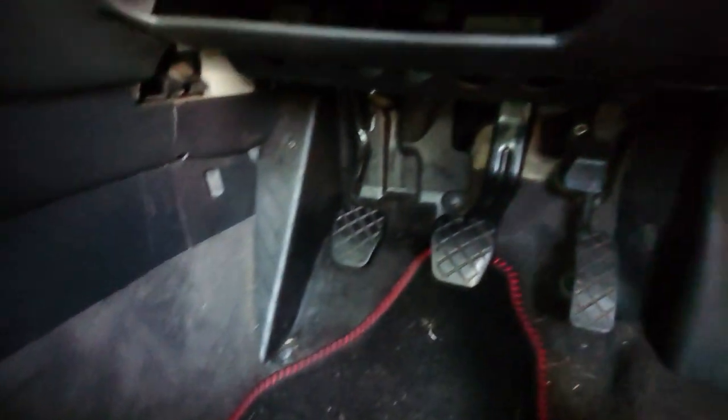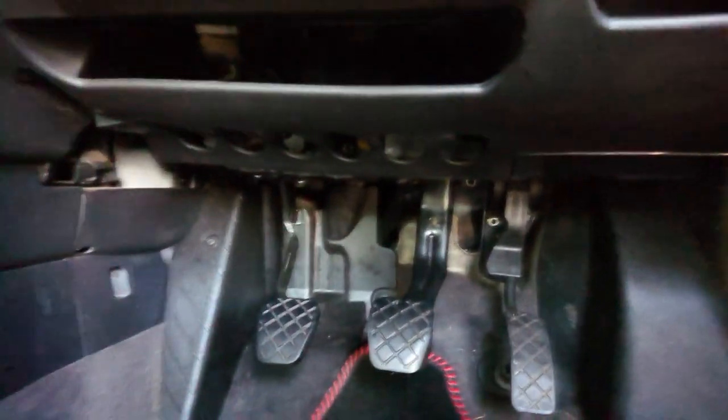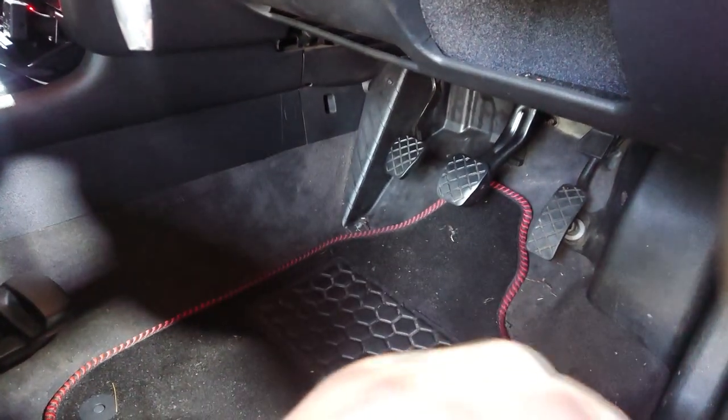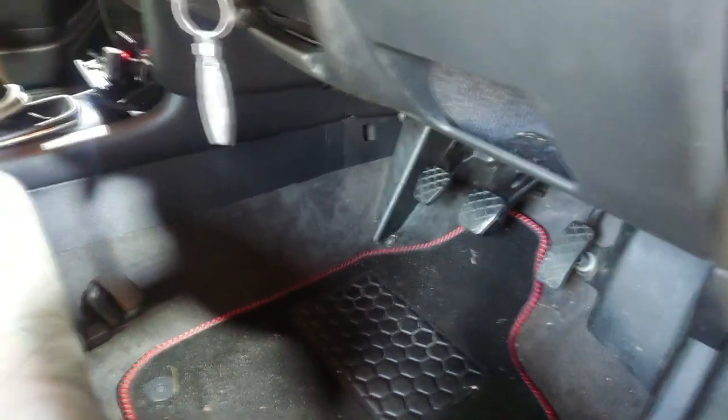We'll just get this new one in the car. As you can see, you pull it in like this and make sure everything's clicked in, then start pumping. With this new one everything should be good. The master cylinder is in on the clutch side. We bled it with a bleed nipple — as you can see we've got it all back in operation. You do the pump technique: press down, release the nipple, tighten it up, let off — and that's it done.